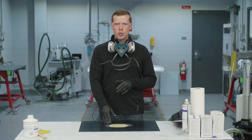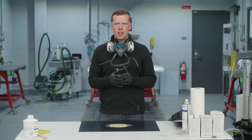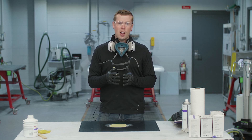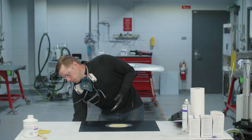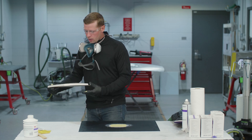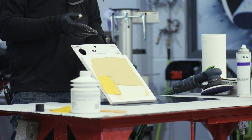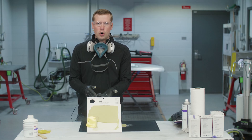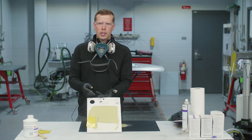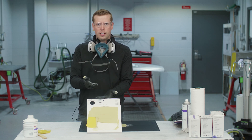One more thing on the body filler application: you'll notice that we applied a single tight coat as well as a couple of thin build coats. Our recommendation is that we don't exceed a quarter inch in any single application of body filler, to avoid air entrapment as well as many other issues. It's strongly recommended that you refer to your OEM recommendations for more information. Also, it's important to use a proper mixing board. We used a 3M mixing board as opposed to cardboard, which is super common. Cardboard should be avoided because we don't know what contaminants are on it — it's often coated with wax, its fibers could transfer into and contaminate the body filler, it could transfer ink, and most cardboard naturally has indentations which could cause folding and lead to air entrapment.